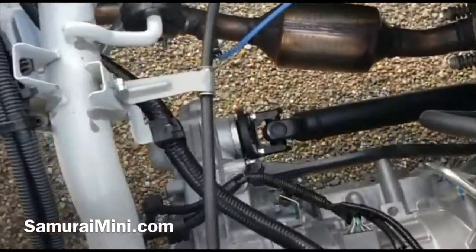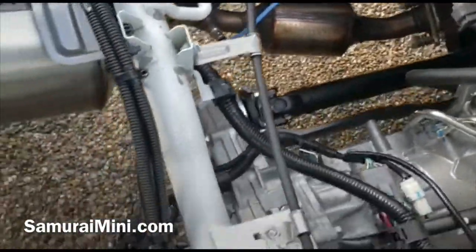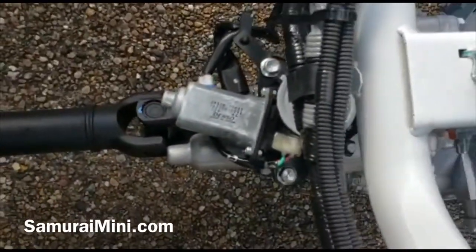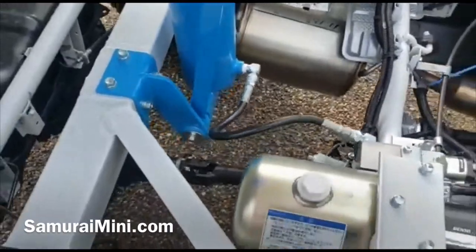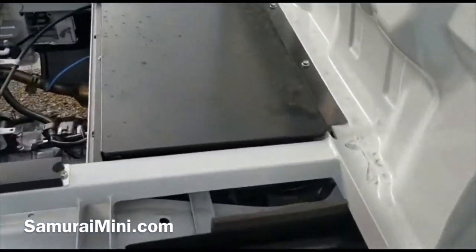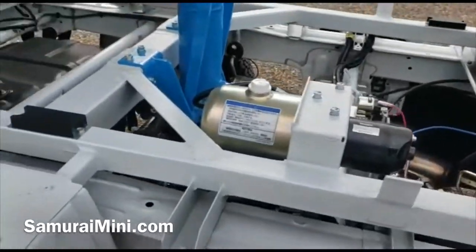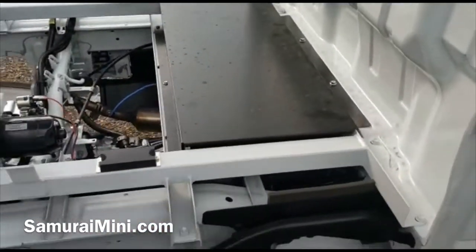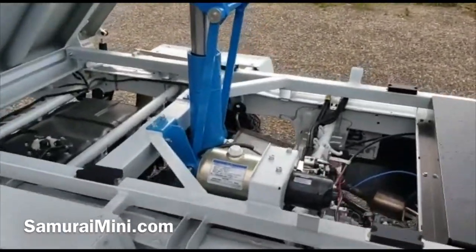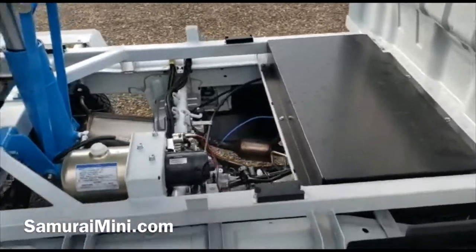The transmission is all new so there's not going to be any trouble. The transfer case is there, and the prop goes to the front wheels to make it four-wheel drive — a little motor there switches the four-wheel drive on, just like I did before with the button. You can see this is mounted on its own chassis; it all bolts onto the truck as a dual chassis, spreading the weight all across the chassis of the truck itself so it doesn't twist and wobble around — makes it very strong.